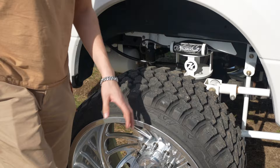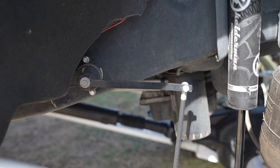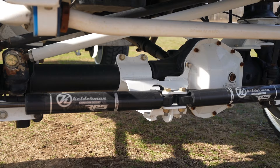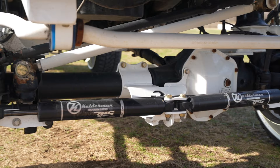You can see that bag completely down. It's got reservoir shocks. This is the sensor so it knows what height to put it at. If the truck's at an angle, it's got a Combat sway bar, new steering components, and two steering stabilizers. I've also got a Country Fab diff cover on it. Don't worry guys, by truck season all these rusty things will be completely coated.